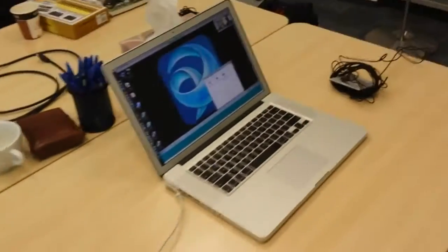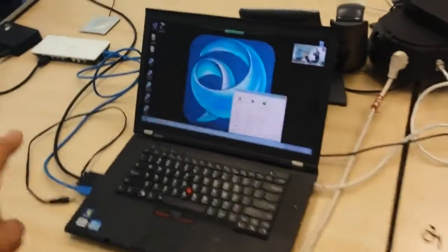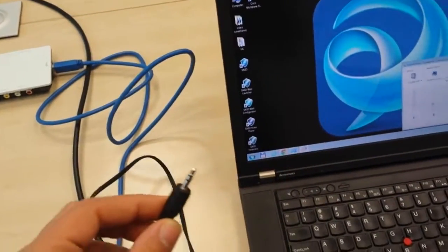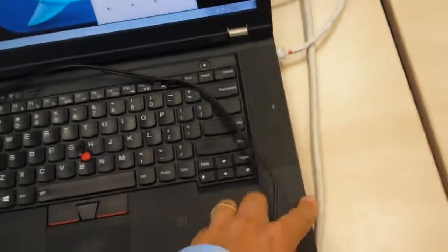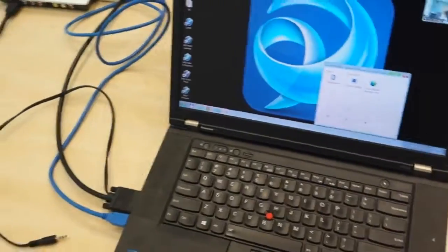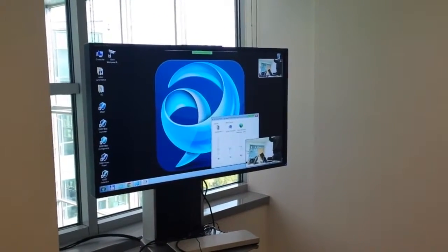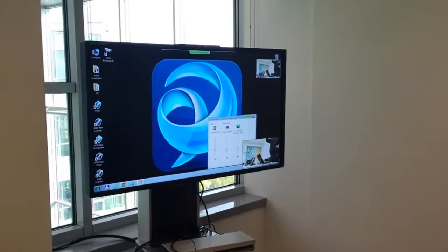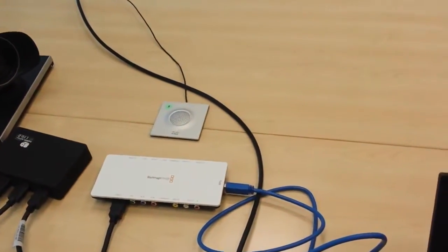Now, if someone from the Webex world asks a question, you're going to be able to hear it via the speakers of this first laptop here. So what you could possibly do is use the audio cable here as well, and feed it into the speakers output of the laptop, so that you could basically hear the Webex participants directly out of your LCD speakers, which are mounted there behind the screen. So that way your experience would be pretty good, but as I said, you would still need to provide for the two microphones here.